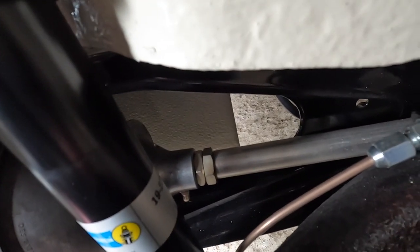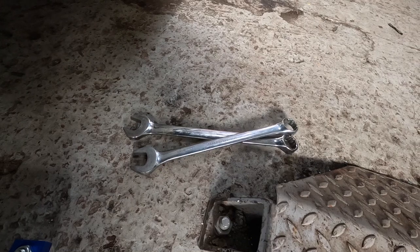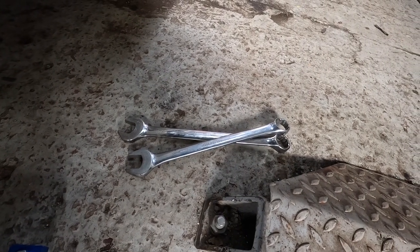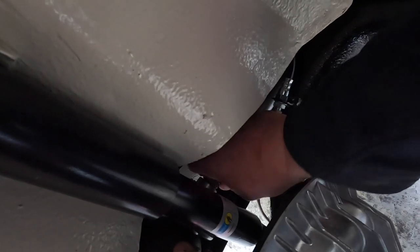You can see the suspension is set up at its lowest setting here. The idea is to wind the threads out and then hold everything in place by tightening up the lock nut. The spanners I was using were a pair of 26mm spanners, but although I haven't checked, I think the actual recommended size is a pair of 1-inch spanners. I'm not sure if setup is trial and error, or whether there's a system to working out how much to turn the nuts, but for now I just had to get the car driving so I could get it home.